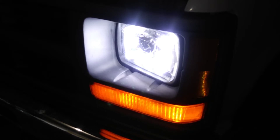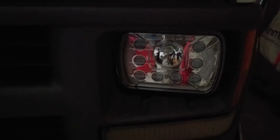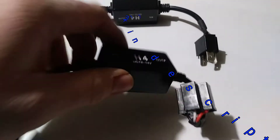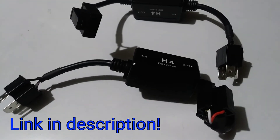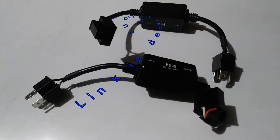After doing a little bit of research, I found out that the voltage is actually a little bit low and these headlights are so sensitive to voltage that they're picking up a little bit of a ripple coming from the alternator. There is a fix for that. What I found was these little adapters — they're basically an inline adapter that you plug one end into your headlight and the other end into your existing wiring harness. I assume what's inside is nothing more than a capacitor that takes the voltage and just kind of evens it out so you don't get a flicker from your alternator.